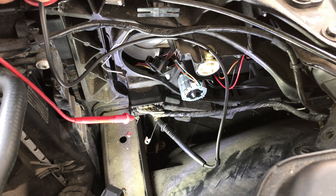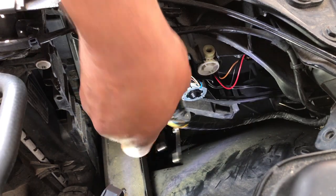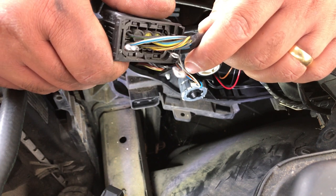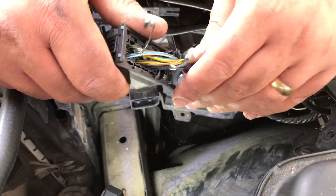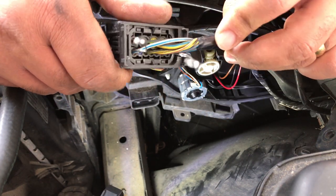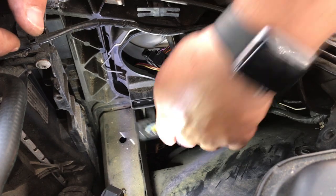So what should I do next? Probably there's a resistance problem in the wiring - that's what I think it is. When Louis sent me a text, he was saying that obviously the voltage for the light to turn on is a lot higher than the voltage for the check. So when the module checks the light bulb, it sends a smaller voltage. So I'm going to check every single wire from here back to the ECU. And if there's no problem there, if the integrity of the wiring is good, I'm going to have to blame the module - there's nothing else I can blame. Let me get everything ready and I'll see you in a bit.